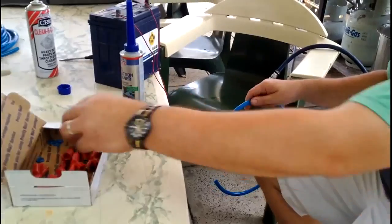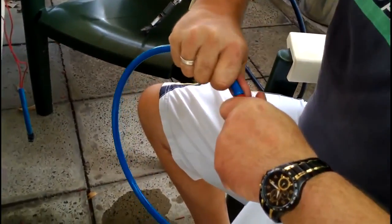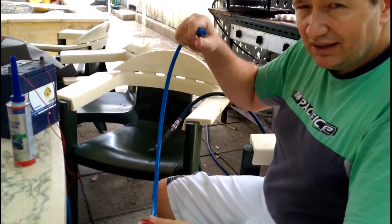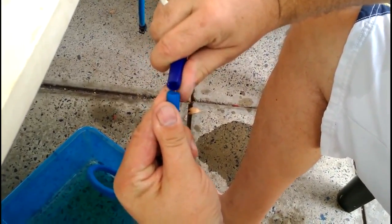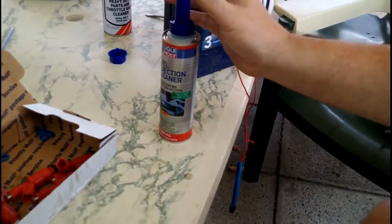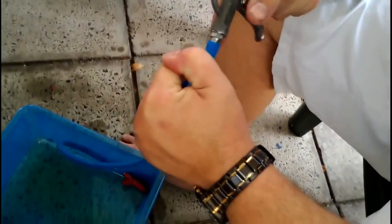The hose I've chosen is a nice tight fit — it pushes on firm so it doesn't come off under pressure, the same as the car's fuel pressure. The length of the tube allows me to put a fair bit of cleaner in it; if it's very short you can't get much cleaning through it. I fill the hose with the cleaning mix until it's full. Some people do this just with a syringe, but syringe pressure just isn't enough to do the job properly, so I use compressed air with the regulator set at three bar.